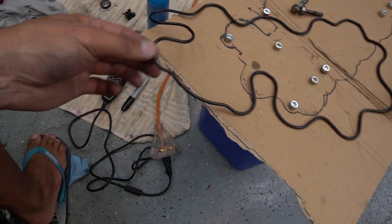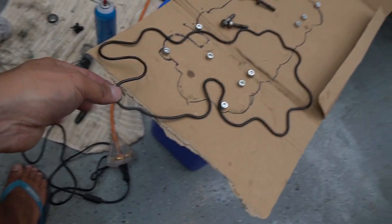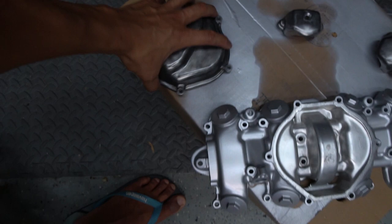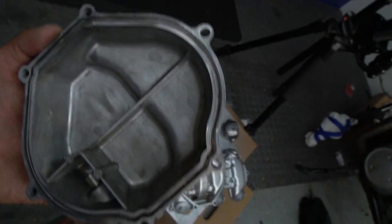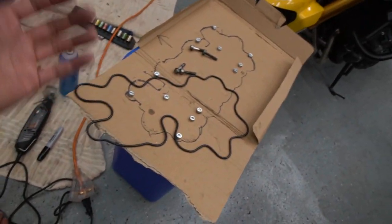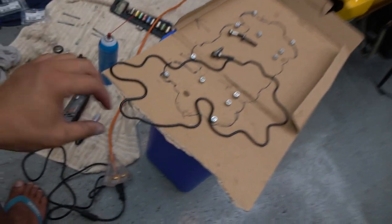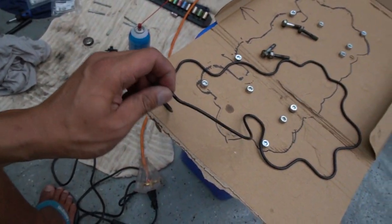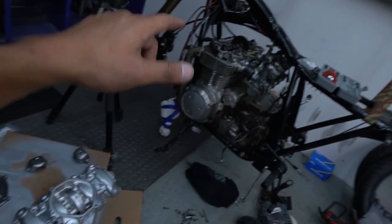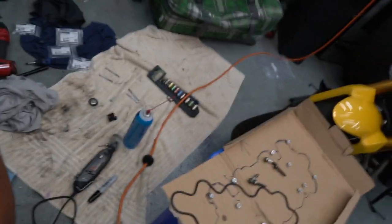I also want to talk about this gasket. This is the OEM gasket going on the valve cover - you have one for the valve cover itself and another smaller piece for the top cover. When CB550 engines see high-temperature conditions and then low-temperature conditions in storage, these rubber gaskets tend to become brittle and don't work as they should, which I think is why this bike was leaking oil up top and the reason I'm doing this project today. So I'm going to put these rubber gaskets in the valve cover and torque everything down.